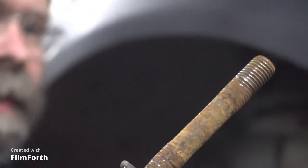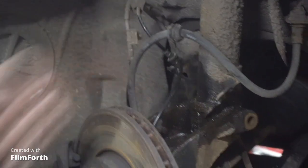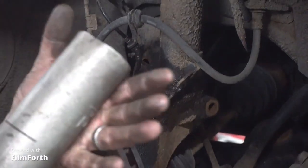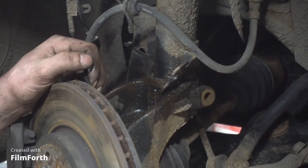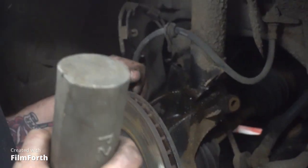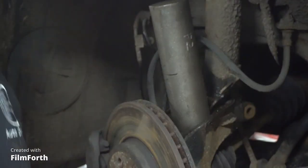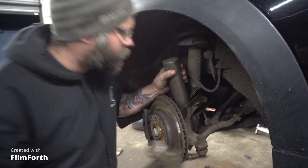She's fairly rusty — I'd say that's an 8 out of 10 on the rust meter. We almost didn't get it out. Now the bolt's out, and I've pre-soaked this in WD-40 beforehand. I'm going to take this big lump of steel and place it on top of the hub without damaging anything. This does two things: it's really heavy so you've got gravity on your side, and it gives you something to hit that isn't the hub. Hopefully she'll just drop out.